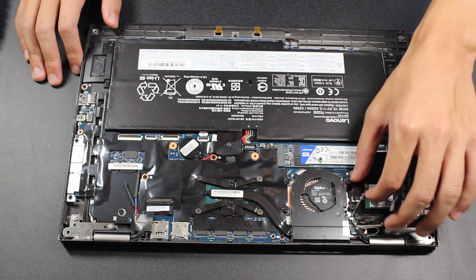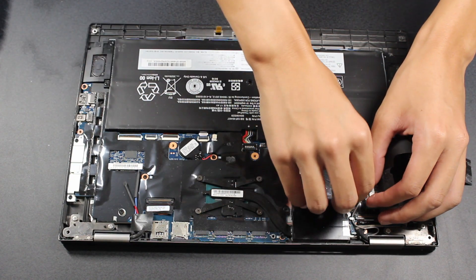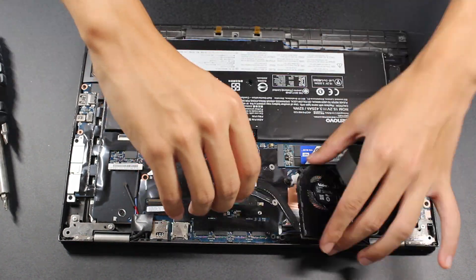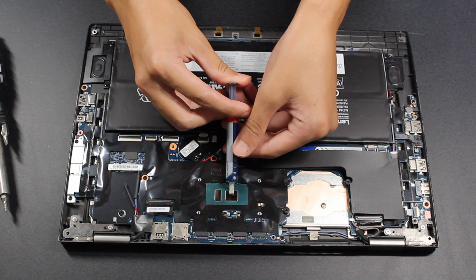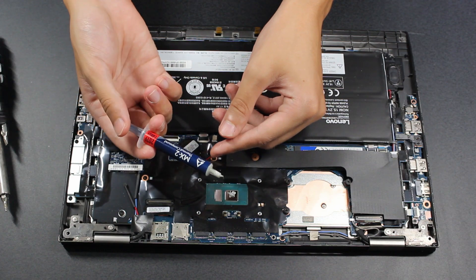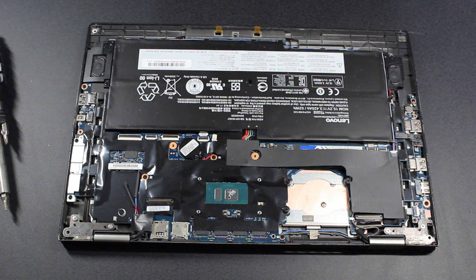To replace the thermal paste, you'll have to remove the CPU heatsink and fan assembly. Begin by unplugging the fan's ribbon cable — lift the tab on the motherboard connector up and gently pull the cable out. Afterwards, unscrew the four screws holding the heatsink in place. Wipe the paste off the CPU die and the heatsink with rubbing alcohol. Then squeeze new thermal paste onto the CPU die. Be sure to add enough so that the heatsink will spread the paste evenly over the whole die before you press it down. If you add too much, you can clean it off with alcohol and try again. Do not apply thermal paste to the smaller PCH die next to the CPU die, as the heatsink is raised and does not contact that die.